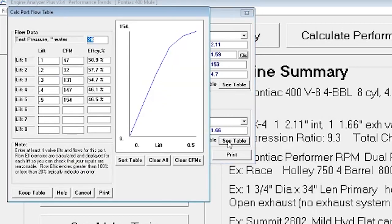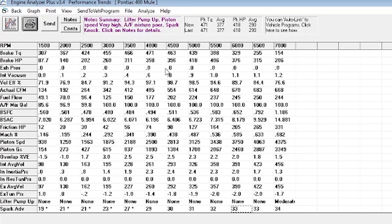Pontiac exhaust is usually not great, so we're going to see a large change here — really low flow. It's pretty easy to make gains there with just basic work. Pontiacs are notorious for having flashing inside the heads, so you can make big differences really quickly and easily without worrying about ruining your heads. We're going to end up around 418 horsepower at 5,000 RPM — that's pretty much what we should expect here.